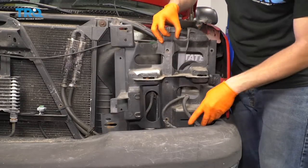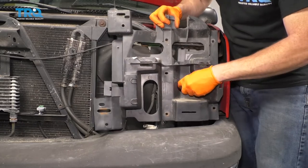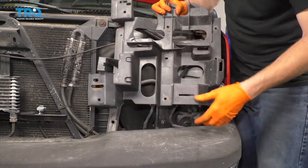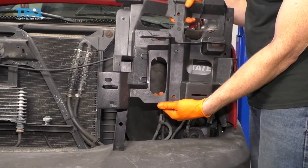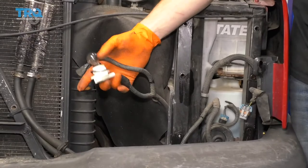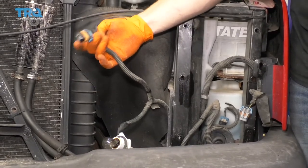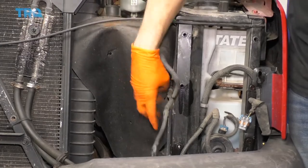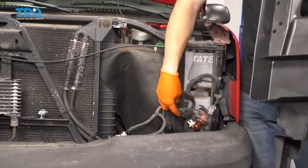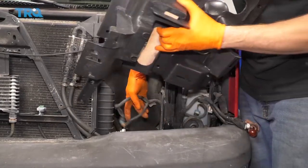Try and grab onto that. Be careful for any bulbs that might be attached or going through anything — you don't want to damage them, of course. Go ahead and remove your unit. So friends, it's time for an install. Let's go ahead and grab our piece. We have our assemblies back here, the pigtails. You want to make sure everything's in good order. This right here is going to go up to your high beam, so it's going to come up along the top. This is going to come through one of the lower holes, and this one is going to go through the lower hole as well. Set all this aside.